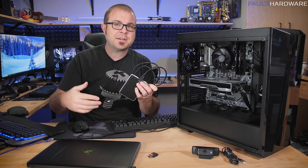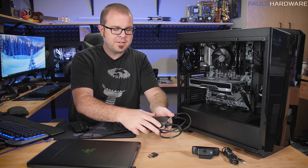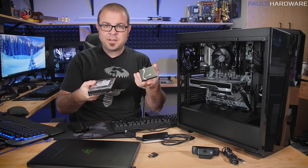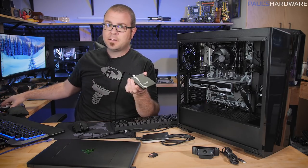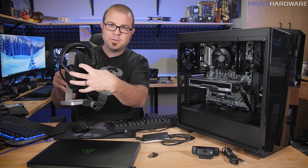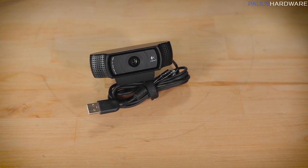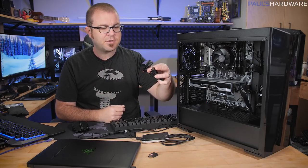My general rule of thumb is have everything saved on at least two drives. Especially if you're talking about personal stuff — pictures, things that aren't replaceable — get it on a storage drive that's external as well as something internal in your computer. You'll also probably want an extra drive installed in the computer. Right now I've only got a single drive installed, but I'm going to be adding one more — either another SSD like this 2.5 inch drive, or a spinning mechanical hard drive like this WD Black 3.5 inch drive. They're both SATA drives, so they both plug in the same way. And finally for that gaming part, I have a headset and a webcam — I'm going to be using this little Logitech C920.